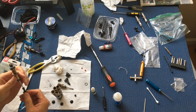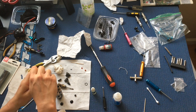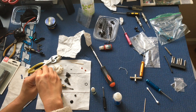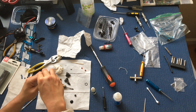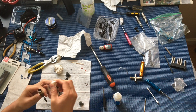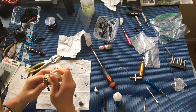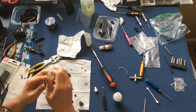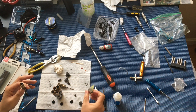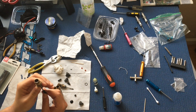It's always handy to have some paper towels on hand when rebuilding shocks. We're going to siphon out a little bit of that fluid — I think we've got a little bit too much in there because of the extra volume that the conical rubber cap, or shock bladder, takes up.